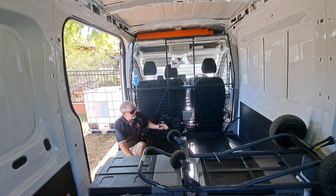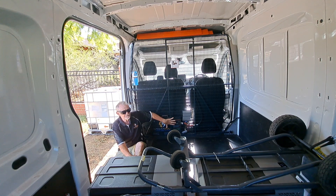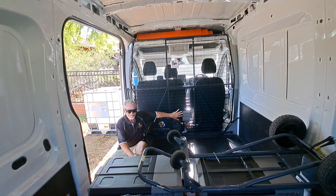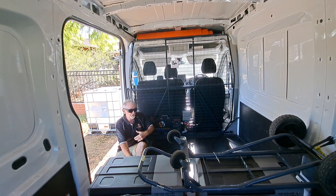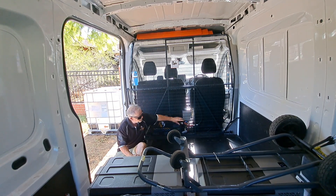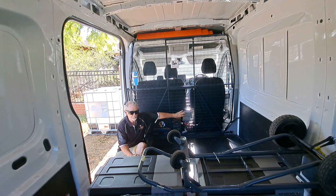The fit out so far — we've got the dual battery setup in place. We have the dual battery here which is a Nomad V6, 105 amp. We do have a 40 amp Madsen DC-DC with solar input. It's only kept in place by cable ties because I haven't decided where I'm going to secure it yet. I'm going to make a base plate which will be powder coated black and then tack it on the inside so you won't see it except for our brand name.